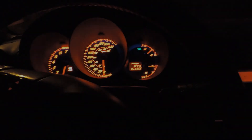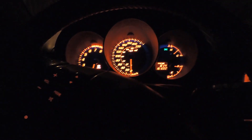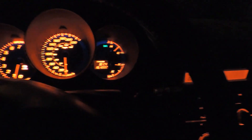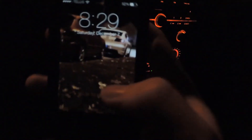One note: yes, this can take your check engine light off your car. But if it's actually a problem, in about three days — or maybe six startups — the check engine light will come back on. I don't really recommend just clearing it repeatedly if it's something serious. It can tell you major problems like misfiring cylinders or transmission issues. You can also check horsepower. For iPhone users, just search 'OBD2 scanner' in the App Store — I find Engine Link is the best, though it does cost money.